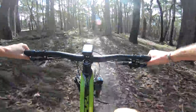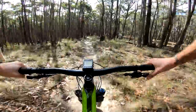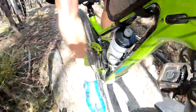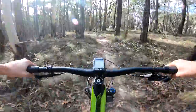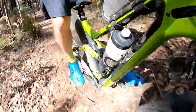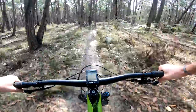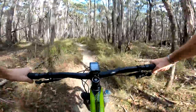Comparing it to other test bikes I've been riding lately, I feel it's got better efficiency than the Giant Trance, on par with the Canyon Neuron CF, but crucially there is better sensitivity with this Merida. You can feel that with the big stroke air shock on the back — the RockShox Deluxe shock has a 55mm stroke, giving 120mm of travel, which is nearly a 2-to-1 leverage ratio — very low.